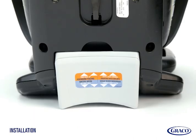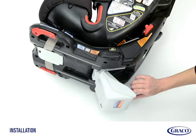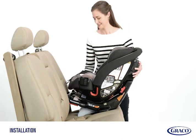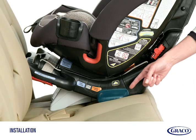Next, check the recline foot. The label shown here shows the correct position for rear facing and forward facing. If the recline foot is in the incorrect position, flip the recline foot over. Push the base against the vehicle seat and make sure the recline foot is making contact with the vehicle seat. Make sure the stability foot fully rests on the vehicle seat.